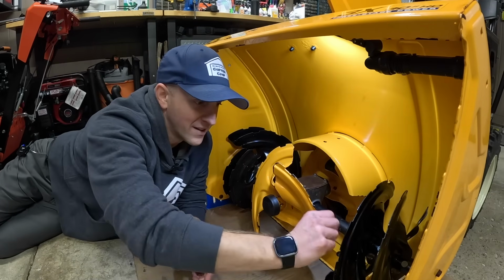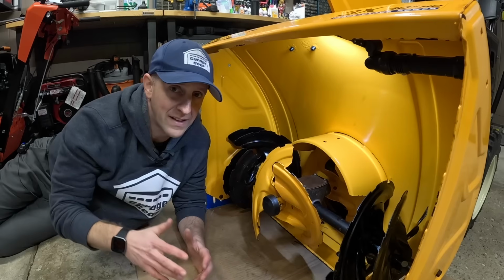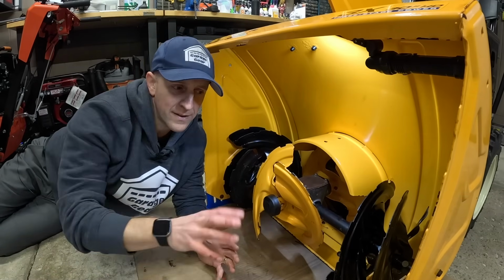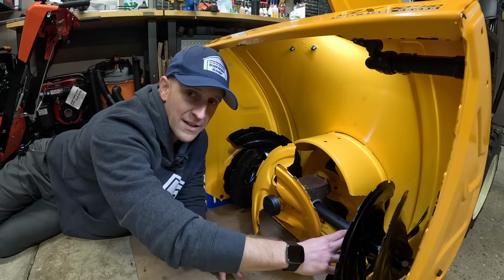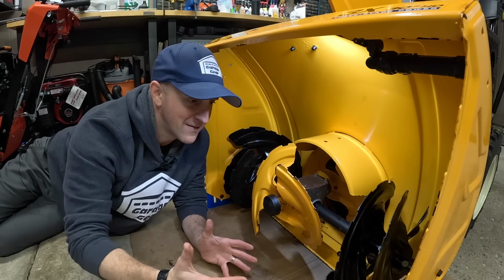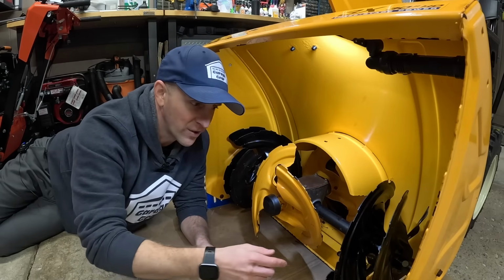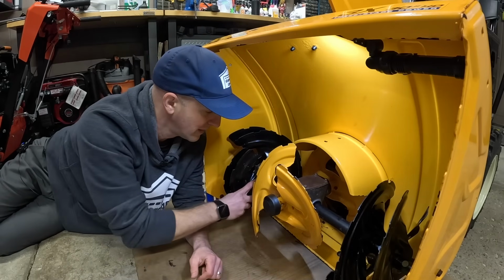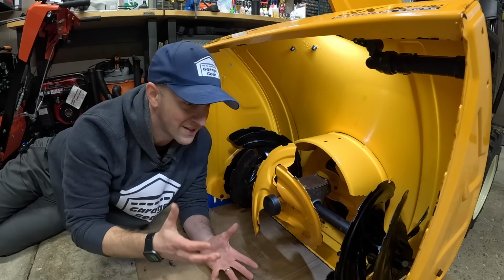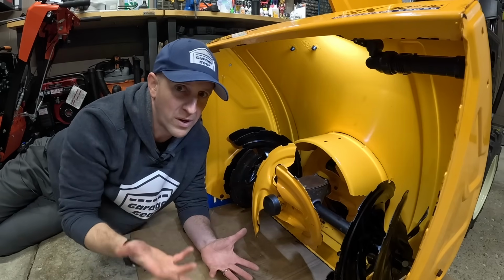It's also a great idea to grease your auger shaft as well. I did a full video on how to do this procedure, and I'll have that link down below in the description. This will help prevent your augers from seizing to that shaft and possibly doing damage to your gearbox. As expensive as this 3X is, this snowblower does not have any grease fittings here on this auger shaft to prevent these augers from seizing, which is pretty crazy considering the cost of this snowblower runs over $2,100.